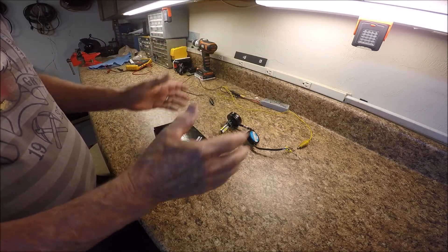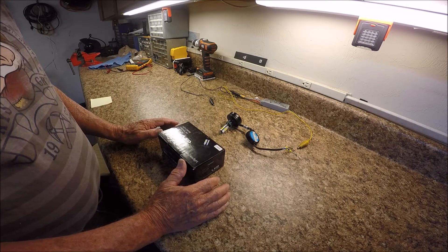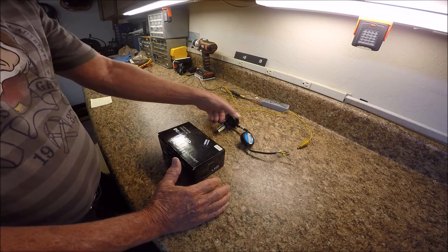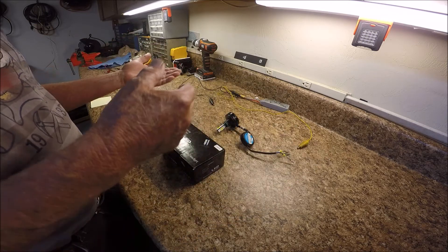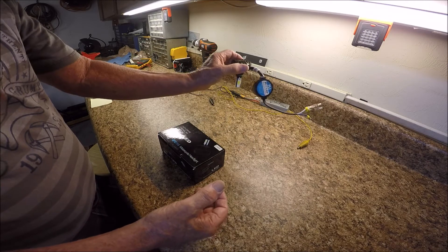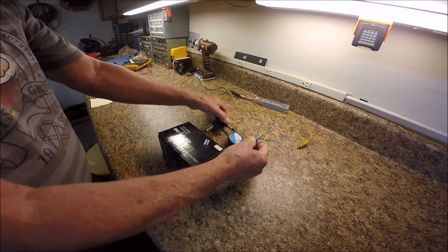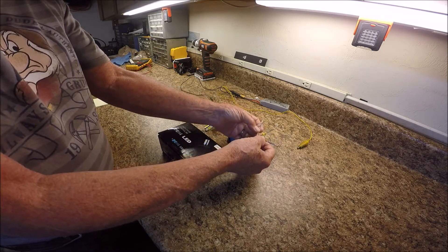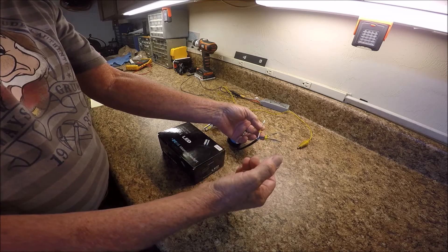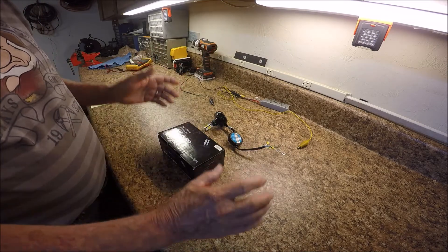The high beam feature is in the center lights, and I'll address that separately. Right now I'm dealing with the Canadian style LED headlights. When I installed mine, I noticed that one light was dim and the other was bright. In investigating, I found that the wires were reversed on one — the two were not wired exactly the same, meaning one of them was wrong.